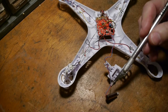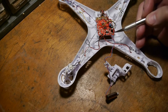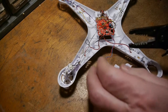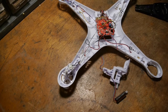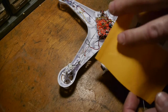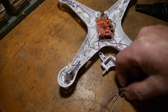The motor is threaded up through the housing and then it goes on over to the circuit board. Instead of unsoldering at the circuit board, I think I'll clip the wires about in half and then solder the new motor onto those wires — that way if I have to replace them again I'm not continuously soldering and unsoldering on the circuit board.